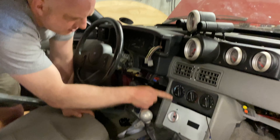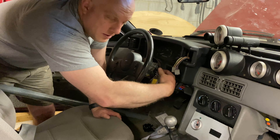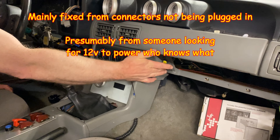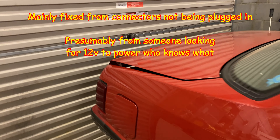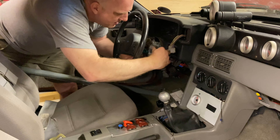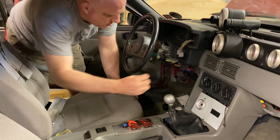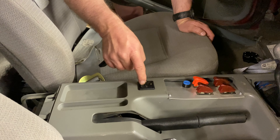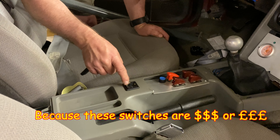Still have to put the binnacle switches back together, but I redid all the wiring behind here and we got a lot of things going on. We got a door chime, a fuel door popper which never worked, a trunk popper which never worked — or the boot, as they call it in the UK. We got dome light action, but I pulled the bulb out so it wouldn't drain the battery. We have power mirror action — that works now. I had to take the switch apart because the grease was so old and crusty in there, so I cleaned it with some carburetor cleaner and stuck it back together.